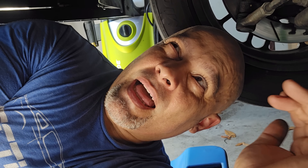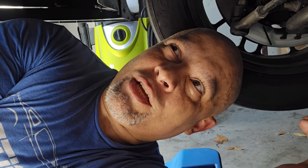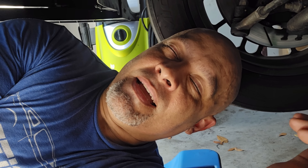A lot of them make up for the lack of belt grip by not necessarily putting a grippier pulley on it — like a grip-tech or something like that — but they widen the ribs, meaning widen the footprint: go from a six-rib to an eight-rib to a ten-rib. On the ZR1 they're 11-rib, rather than going for a textured pulley to have the belt grip as much as possible on the supercharger.